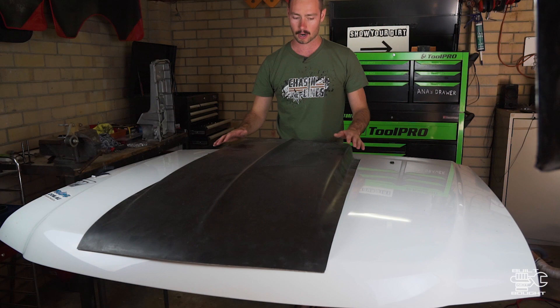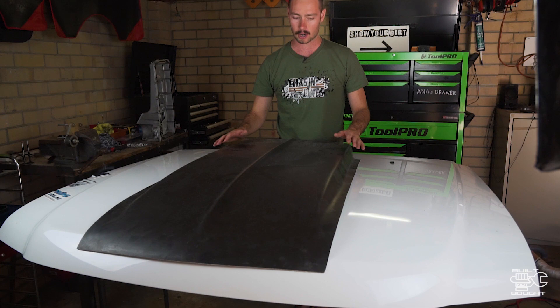I'm going to paint it white. And pretty much that's what I'm going to take you through now. The plan is really just to trim some of these edges, get it sitting right, chuck a couple of pop rivets in intermittent places along it, and then use fiberglass and bog to try and smooth this thing out.